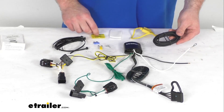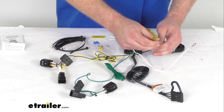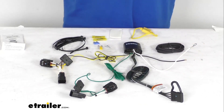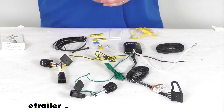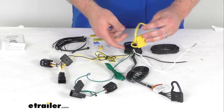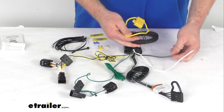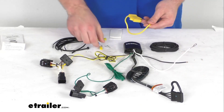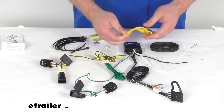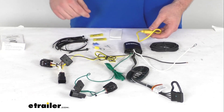They do include some zip ties to keep that up off the ground. Once you get to your battery compartment, they do include butt connectors with heat shrink on them so you get a nice solid connection since it's going to be outside the vehicle — shrink those down and you don't have to worry about water getting in there. Once you get up to your battery, you'll snip the fuse holder here. One end will connect to your line wire running back to your module, and the other end gets the ring terminal that will go onto the positive post on your battery. Then after you get everything connected, you can put in your fuse and it will all work properly.